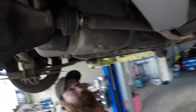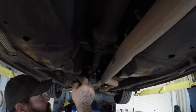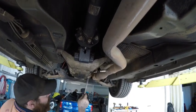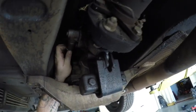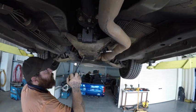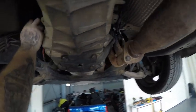Tailshaft - they differ: 8mm bolts on this one, some have 10mm, and 13s and 18-19s here. That's how you take your tailshaft out. We're going to drain the gearbox - drain bolts here, get the fluid out so we don't have a mess. There's a bit of wiring on this gearbox - speed sensor, reverse sensor, there's a lot more on that side. Get it all off and out of the way. We'll get the whole gearbox mount out of the way and then separate the box from the bell housing.